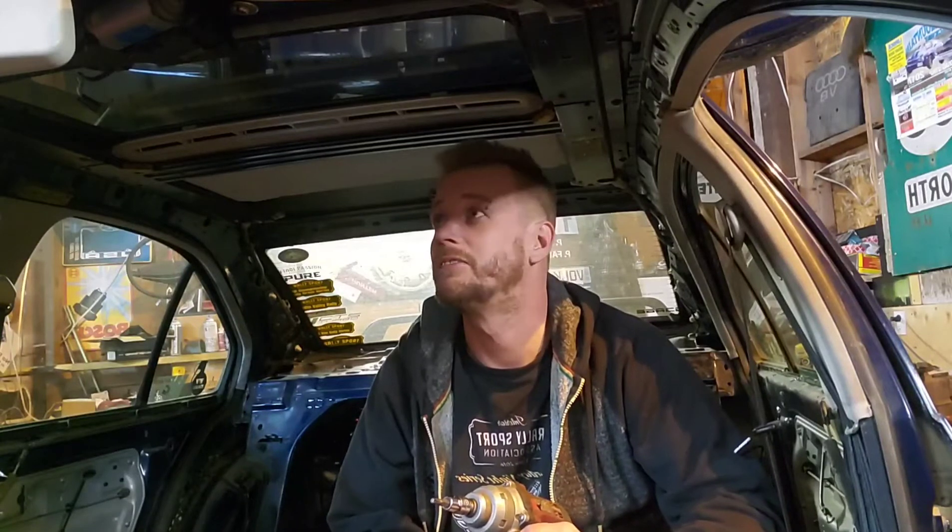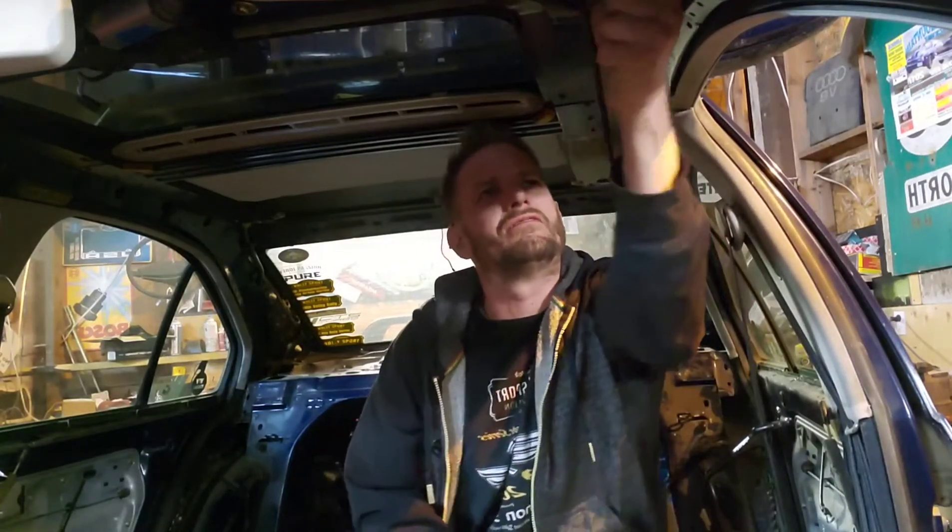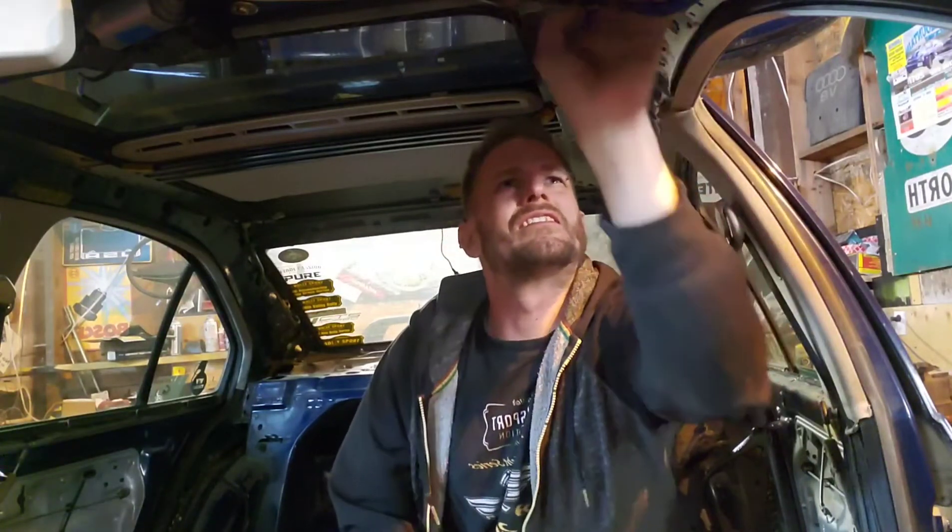I think right now I'm just going to take the sunroof out and set it aside. I want to get that weight for the comparison. Impact gun, T30 — I'm going to buzz this off of here, and hopefully not drop it on my head like I normally would. I'll pull the sunroof drain tubes down and take this thing off real quick.